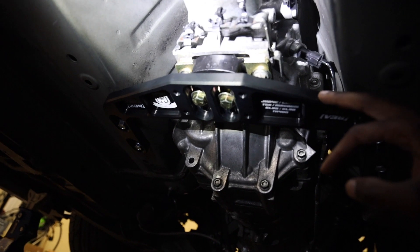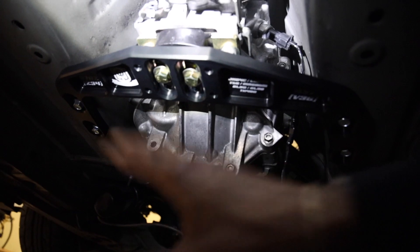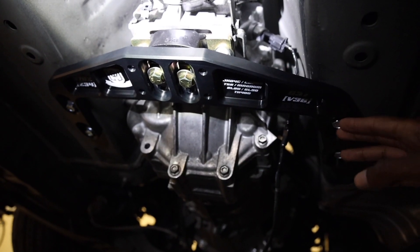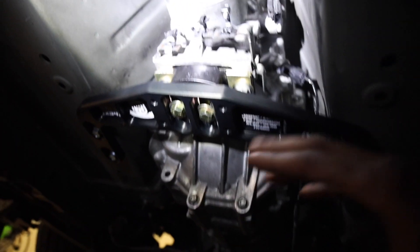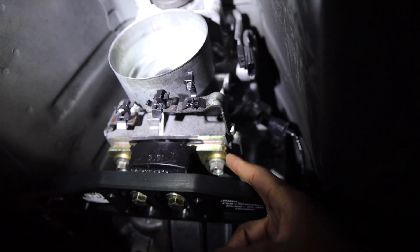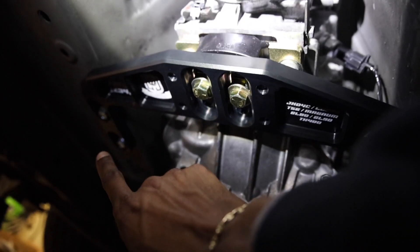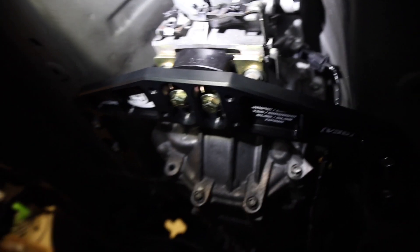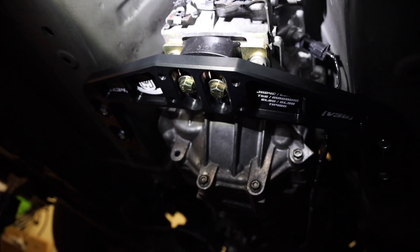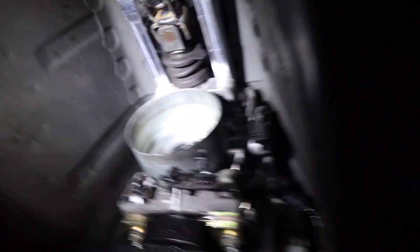It is on there but it did take a bunch of finagling — put one bolt here, put another bolt here, tighten that side down, tighten this side down, then loosen something. But you guys can see I have the polyurethane bushing in here fully secure to the transmission, the actual transmission mount is fully bolted down with both bolts on each side plus the two in the middle. This thing is holding itself up, which is very nice to see. And the outlet right here looks to be directly center.